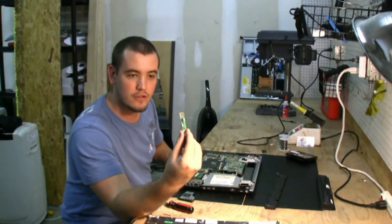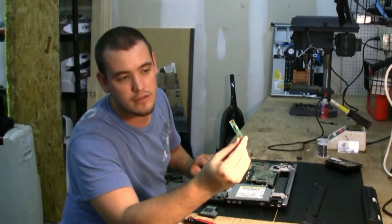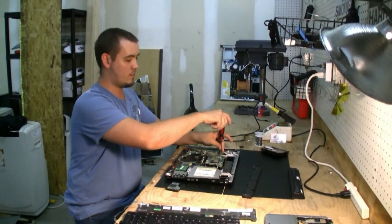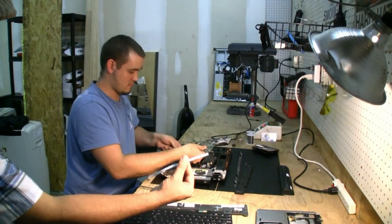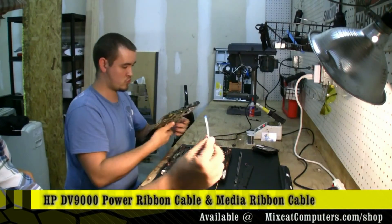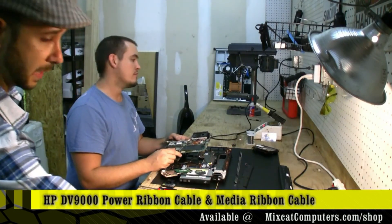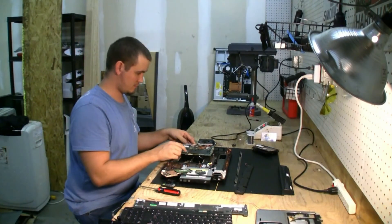Now this is the wireless controller switchboard for the DV9000. What we're going to do is modify this and make it where this can control the fan. We're also going to disable the switch capability for the board, so that way the wireless is constantly on. Here's an example of one of those cables — a little bit longer than standard, but you can actually fold these to fit as needed on the actual laptop. It's a thicker cable that really holds up nice, and usually when we do a repair we replace those cables.